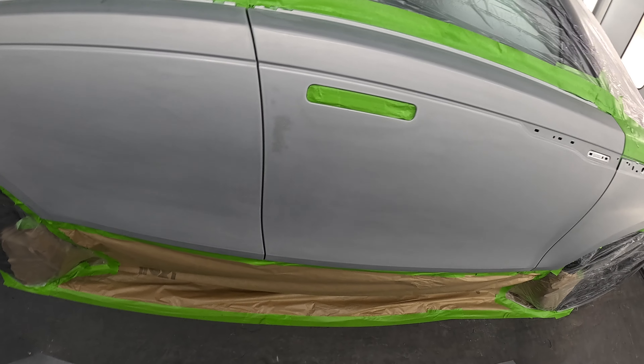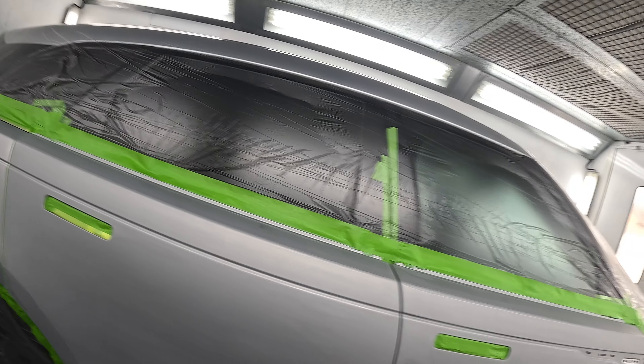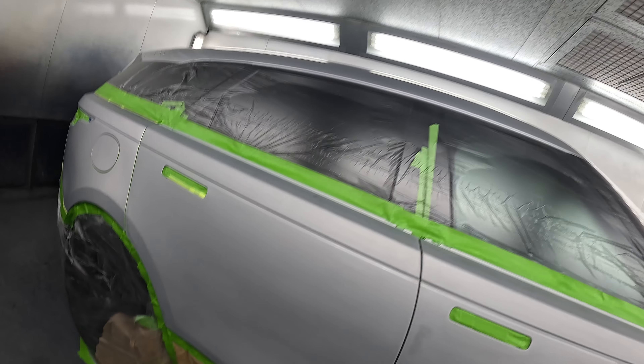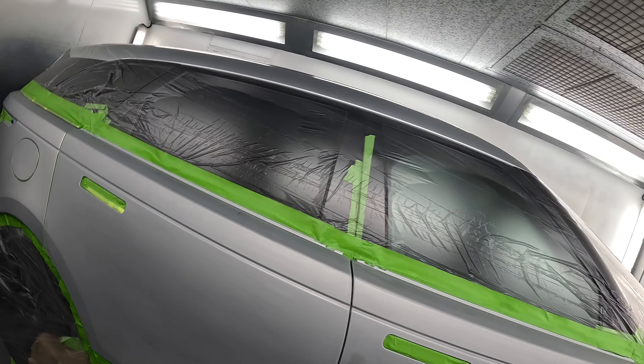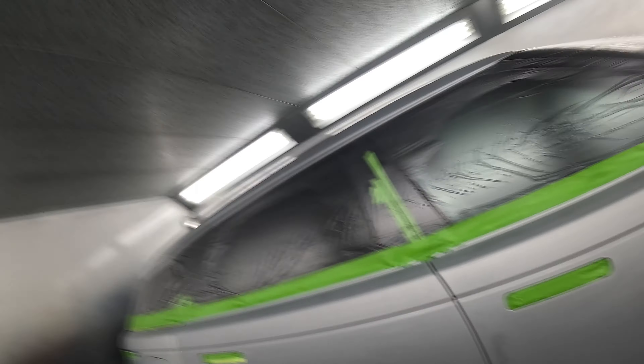There are a few little breakthroughs on this. The paint was a little bit chewy, felt a little bit gummy when rubbing it down — it was blocking and clogging up the sandpaper. So I was in two minds whether to two-pack prime these doors just to seal it in, a couple of thin coats, then block it all down and prep it, but I'd probably end up breaking through again on edges.